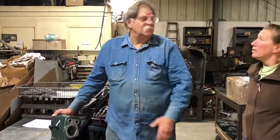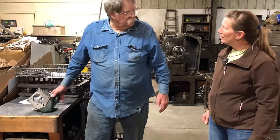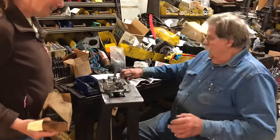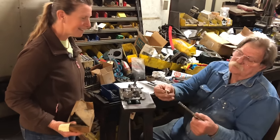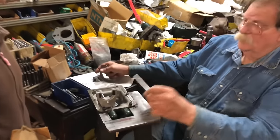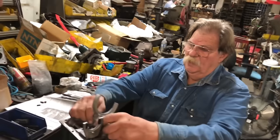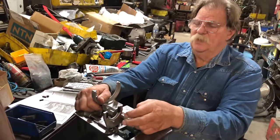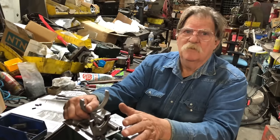Before we put cases together we just flip them over — if there are no bubbles we put them together. The flawed spot is always in that same position, related to the casting orientation. Now for the shift rail shims — I've got little shims on both sides. When installed, one goes on each side of the detent: front and rear. When it shifts back it hits the rear shim, when it shifts forward it hits the front shim, preventing the race car driver from over-shifting.